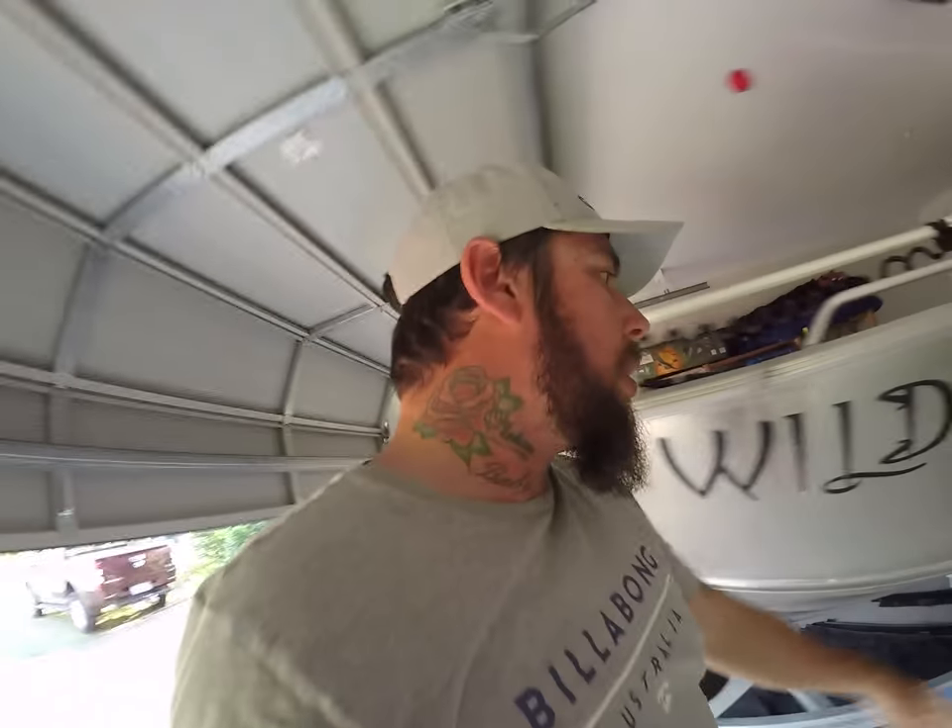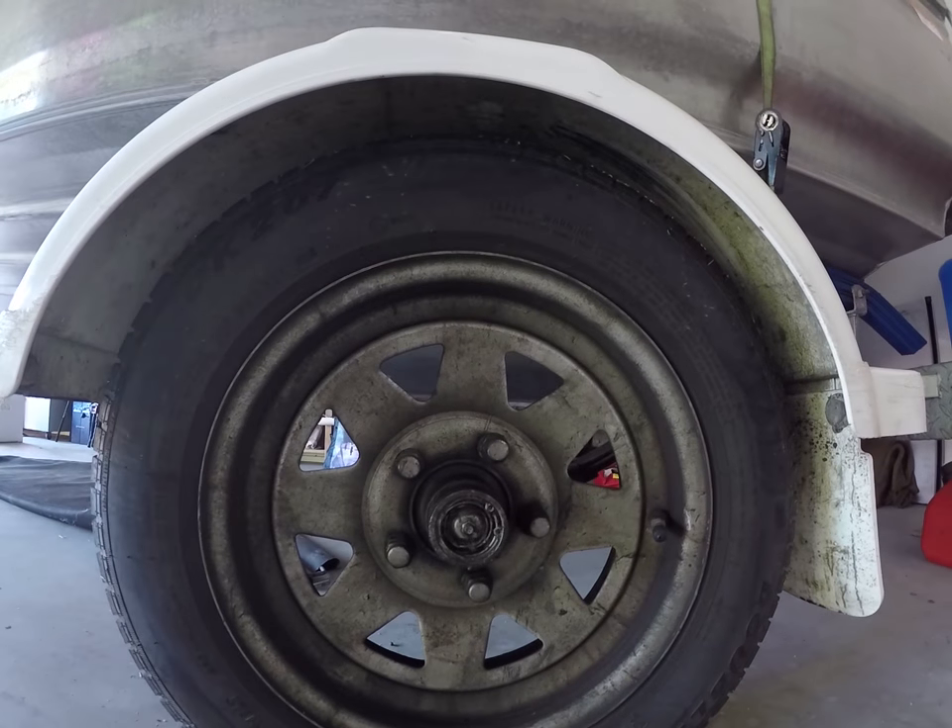The main thing I do is wash the hell out of it every afternoon when I come back. I get the hose under there and make sure I'm soaking the hull and the trailer with fresh water thoroughly. You can get bearing buddies as well - keep squeezing, get yourself a grease gun, keep filling them up and you shouldn't have too many problems.